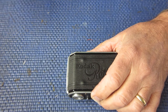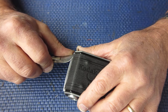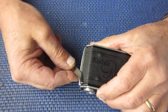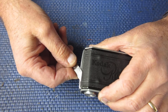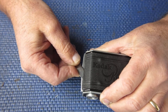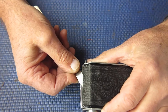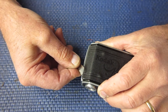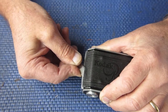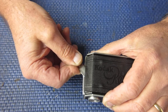That wasn't too bad. Now here I'm levering the leather up as much as cutting underneath it. I'm taking great care to keep a lot of downward pressure on my scalpel to keep that blade hard back against the metal surface, not letting it rise up into the leather, because I don't want to cut through the leather.